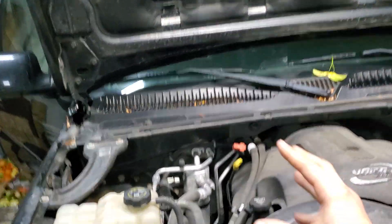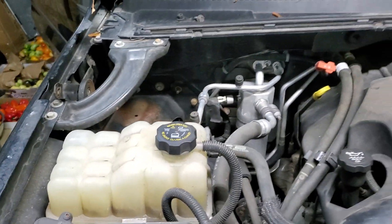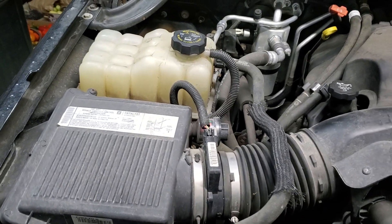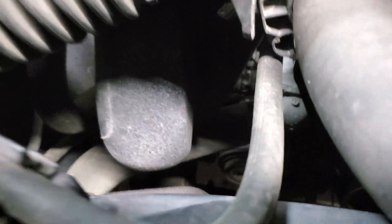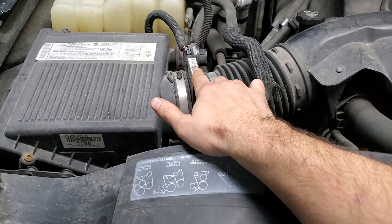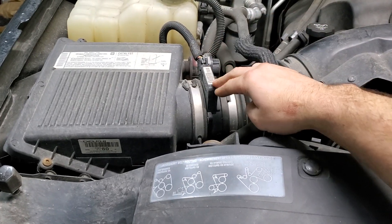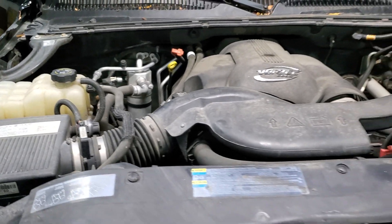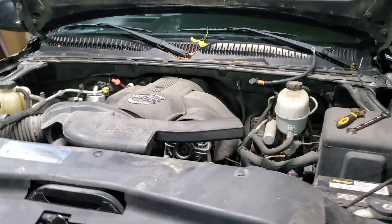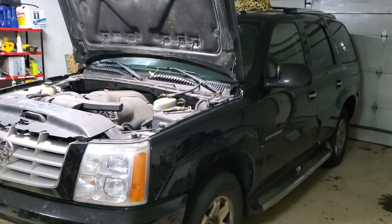I want to put the turbo right in this area and keep the AC, heat, and as much of the factory setup as possible. I even thought about hiding the turbo inside the factory airbox — there's a big open area there which would be really cool. I also want to keep the MAF sensor and try a MAF-based tune instead of speed density, just because I've never done it before and I want to try to keep it looking factory. I just want to have fun with this thing — it's going to be really cheap to do, we'll get good content out of it.